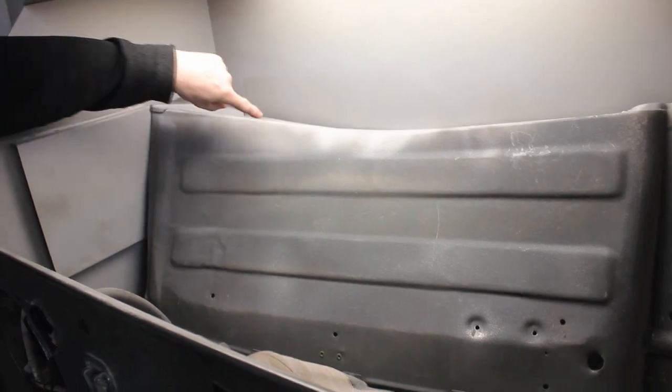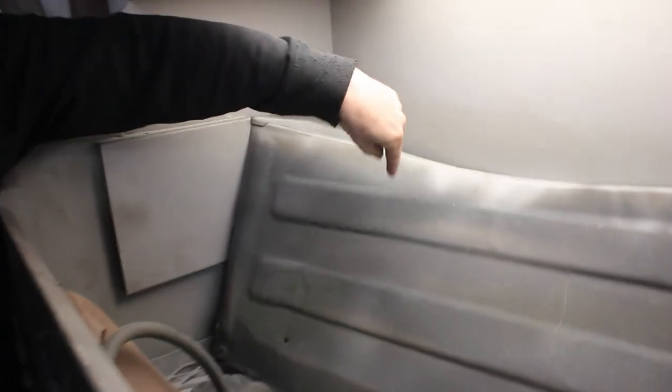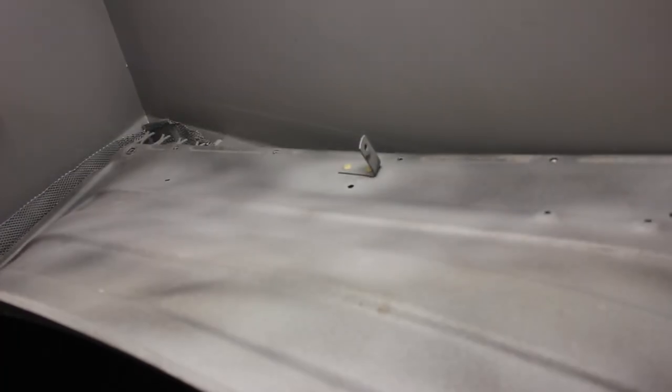They had a little surface rust around the sides. Well, it's turned into everything under the black. It's got a brown surface rust. So I've glass beaded a good bit of this side, and I'm going to glass bead more. Every time I stop, there's a spot like this. See that brown right there?